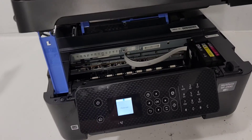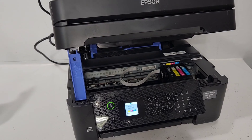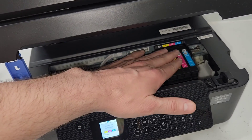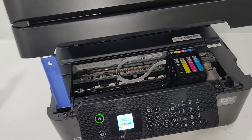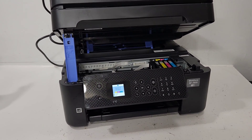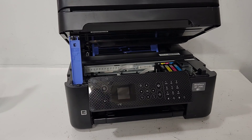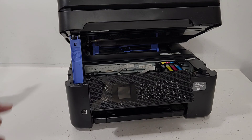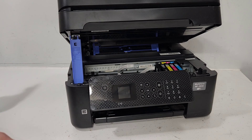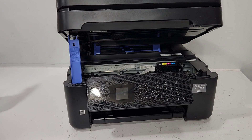The first thing I did was move the printhead over there, and we're going to go ahead and unplug the printer at this point. The reason for that is I don't want this carrier to be locked on the right side. That shouldn't hurt it if you're doing that once in a while. We're going to use a Phillips head screwdriver for most of the screws, and sometimes a flat head screwdriver just to open some clips. So let's remove the ink cartridges for now — that will give us access to the printhead.